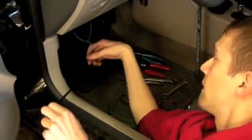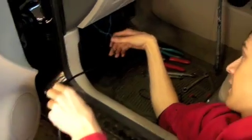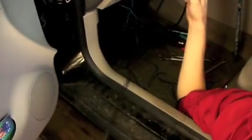These are our wires from our solenoid. We've connected our switch coming down, goes to here. And then the other one is our ground. Our ground we've run all the way to the back, and it's hooked up to our chassis in a bolt. And if you have any questions about that, just give us a shout. And our next step is going to be to connect it to the battery and fire it up.